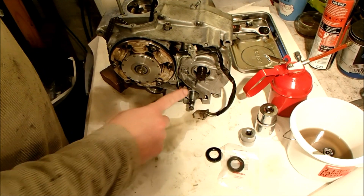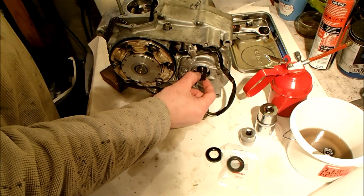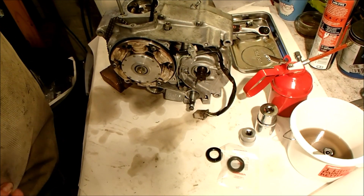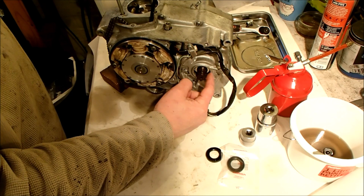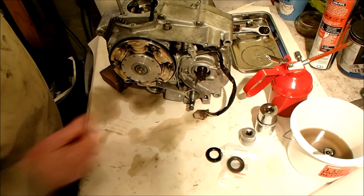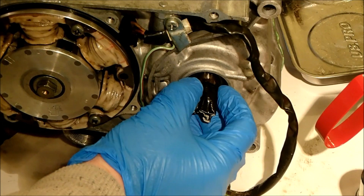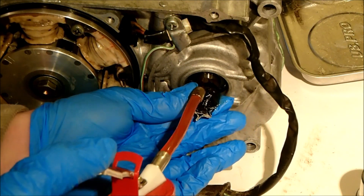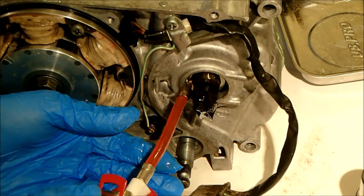It's time to fit the final drive oil seal — once that's in there's less chance of debris getting in and reaching the bearing behind it. I need to get the new seal over all this spline work, and there's a groove cut around the shaft for the locking plate, which is likely to tear a seal to shreds. So I'm going to put a little tape around the shaft to allow the seal to slide over the splines, then use plenty of oil at this end to let it ramp up onto the shaft. I'll use the old seal and a large socket to drive the new seal home. I've used duct tape rather than masking tape because its plasticky finish should let it slip easier.